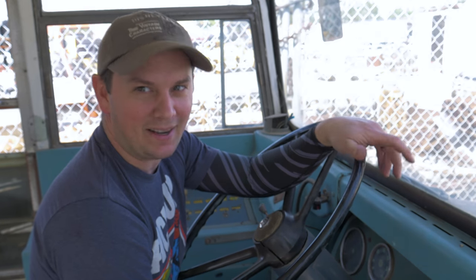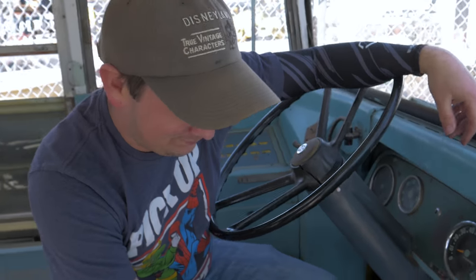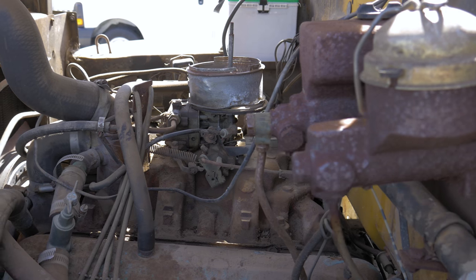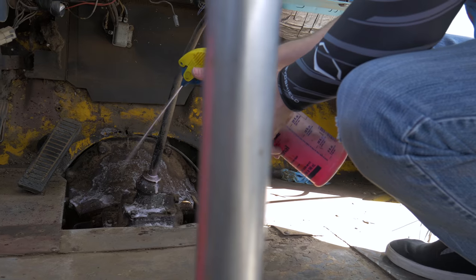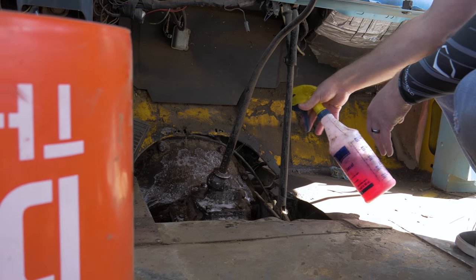That way when they're like, 'why is it always Nick talking?' — it's because you're behind the camera and I don't know how to camera. Supposedly the clutch and the brake master cylinder were replaced about 10 years ago and then it was just parked. I have no reason to believe it shouldn't work. I think we just need to bleed them — I don't think they bled them very well. We had like no brakes. The clutch is kind of iffy.